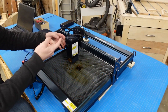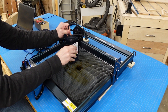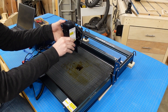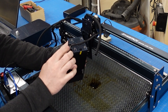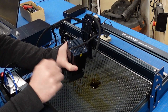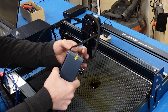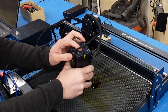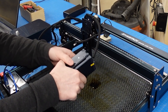Now pulling in closer for a look at the module — your air inlet is right on top and this rubber hose will pop right off. One thing I'm not too big a fan of is they really do recess this connector in here, so to pull it out you almost have to pull on the wires or try to get something in on those little tabs. I'd like to see that be a little more accessible without yanking on the wires, because that's a good way to break or pull pins out.